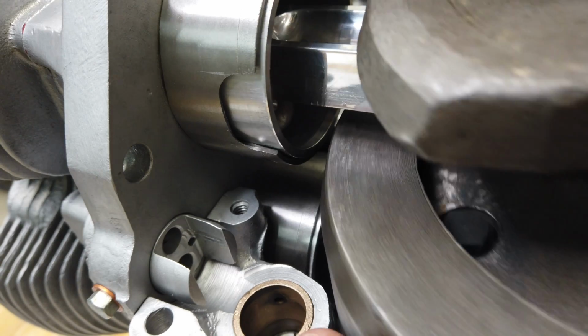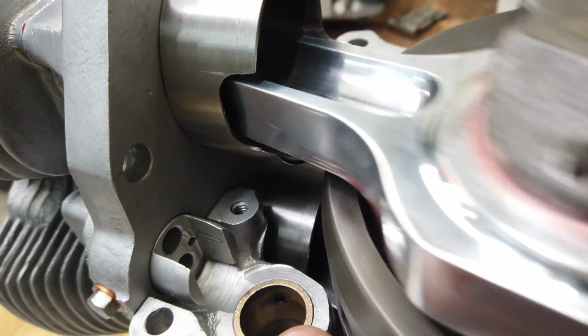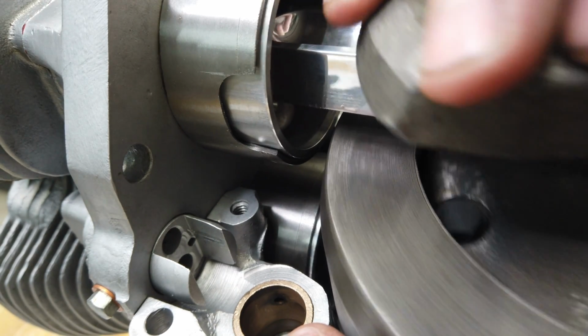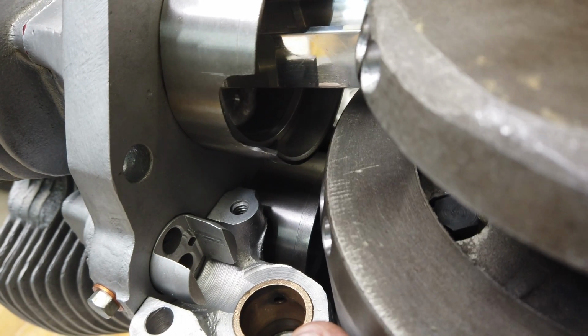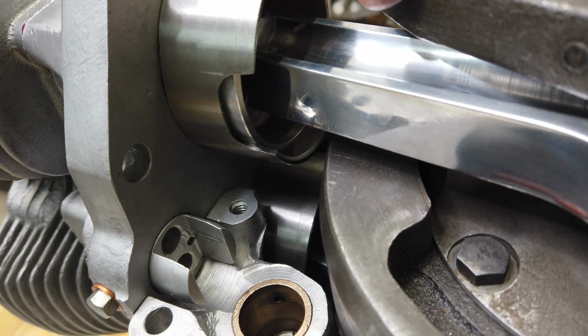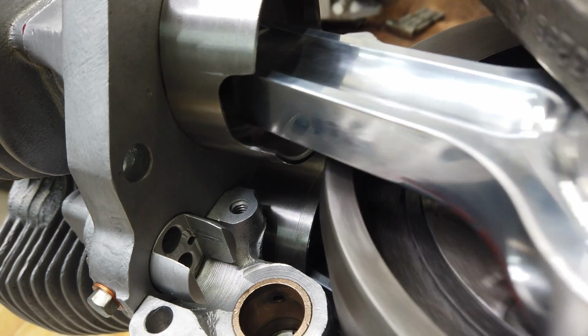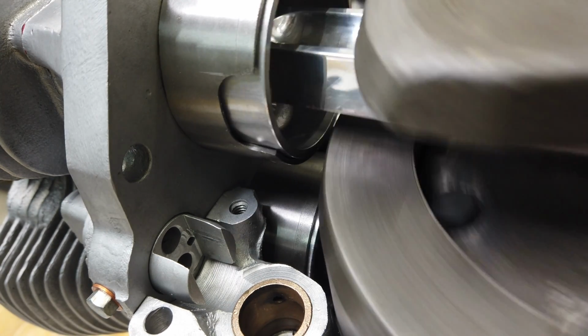Obviously, I wanted to point out, there's no rings on the pistons right now. They're just floating in there. That's why they move so freely, and I'm not doing any harm to the bore. But you always want to do this. If you're swapping parts, mismatching things, any of that kind of goofing around, double check. Don't do anything and find out the hard way.